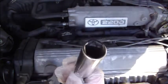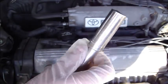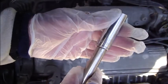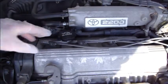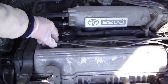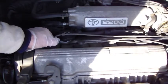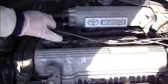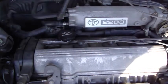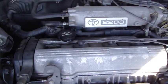You need a spark plug socket — the size is 16mm. When we start to open these spark plugs, the idea is that I take my hand in here and pull out this spark plug wire carefully, in this way. Be careful how you pull it.